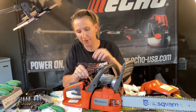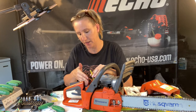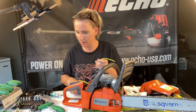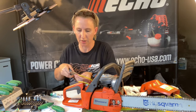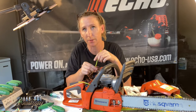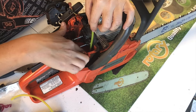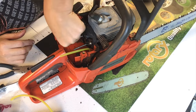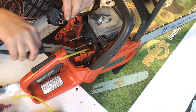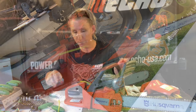For the return line, I take a line about seven to eight inches, cut the end sideways — straight down the center, leaving it at a point — then stick it down in there and tug it through with hemostats all the way to the back, because it just has to be tugged in a little bit to return the gas. That's where your return line goes — in the bottom right back side. Then your fuel filter line comes out of this grommet. We're going to pull it out just a little bit so it can reach back around to the other side of the carburetor like it's supposed to. Make sure it's still on that right side of the tank.